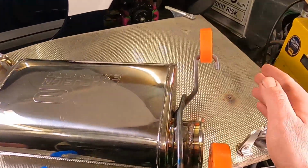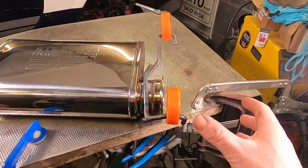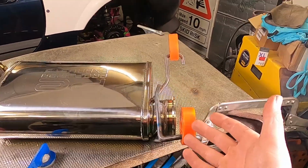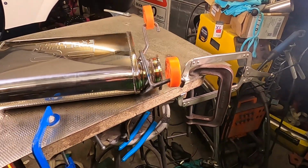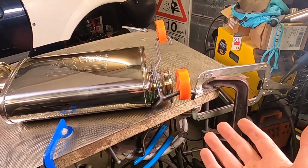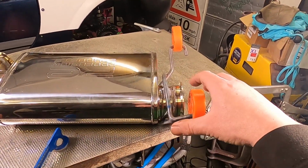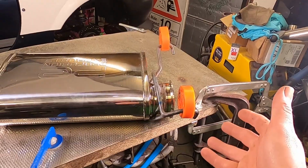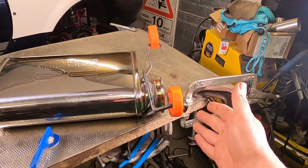And you may have noticed on this end I have put a V-band, and that's for a good reason. I now want to make an interchangeable exhaust tip. First reason is so I could change what style exhaust tip I have, and two, if I'm doing backwards entries, the exhaust tip is probably going to be the first thing to be hit, and if that's damaged I could just disconnect it from the back box here and change it to a different one. So I'm going to get this back in the car and start making my exhaust tip.